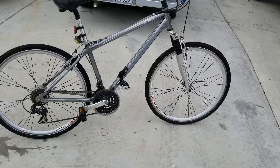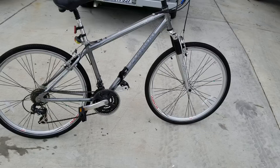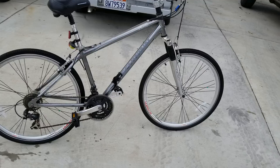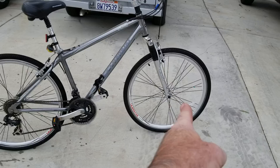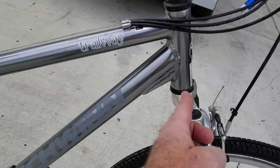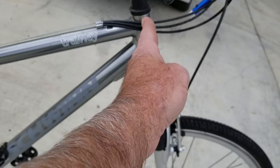The best way to explain this is always a bicycle. Most of us have ridden a bicycle, and if you're a little bit crazy, you do some of this stuff so you get to know what positive and negative caster are. Bicycles have the nut in front of the wheel — the axis is here and this part is in front of the axis. And what that is called is positive caster.